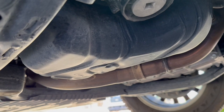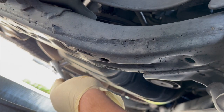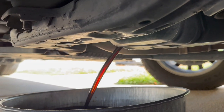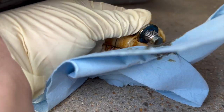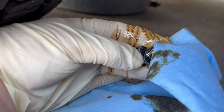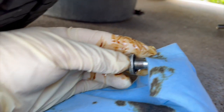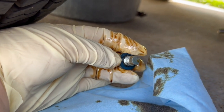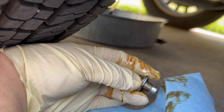I'm going to reach my ratchet in there and aim the oil pan up on the oil plug. Once the oil plug is out, let the oil drain completely. Also add a pair of gloves and a rag to your list of items needed. The compression washer is on the oil plug, so we're going to take that off and change it. Sometimes they get stuck on the actual oil pan reservoir, so make sure that comes off before you put the new one on — if there are two compression washers on there, it will leak between them.